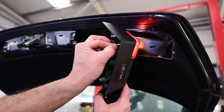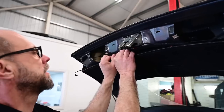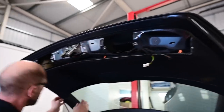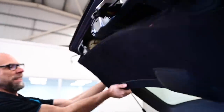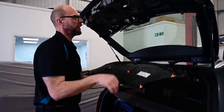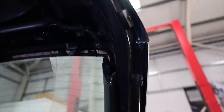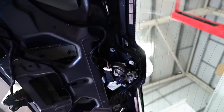This one's just a straight pull off, and that one is a pinch. These bits are tight. On the leading edge you've got these clips — just four of those. The important thing when it goes back in is these slides; you have to push it up like that. Then we've got access in there to the number plate lights, which is just through from here.